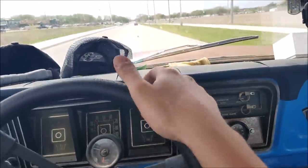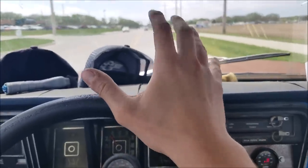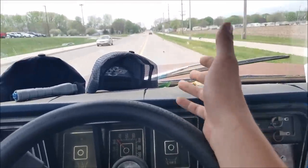For me, with this big heavy truck, the two middle springs — not the lightest, but not the heaviest — worked out the best. You can use combinations of springs to tailor your timing curve, and I've seen the best results setting this truck up with a 302 and a 5-speed in this long bed F100 that way. Varying your engine load at different RPM ranges — like 1500, 2000, 2500, and 3000 RPM in a tall gear and monitoring how your engine responds — gives you a very good window into what your engine wants for ignition timing. The tall gear is important because it's our limiter: whatever works for it will work for the gears below it. Whatever works for fourth is going to work for first, second, and third without any issues.